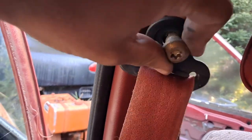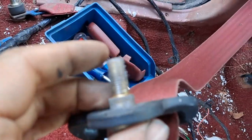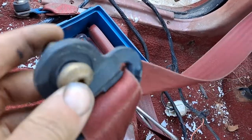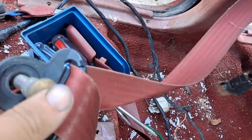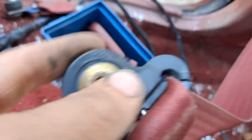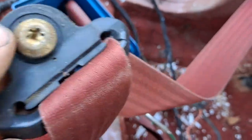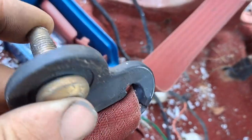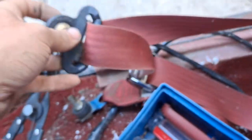We'll remove this top one here. The top one is still just a T50, just like the other one. On my EXPs these all seem to be the same — tops and bottoms. There's nothing to this one, it's just a bolt. And then the seat belt pivot retainer actually has a coating of plastic rubber on it, so that alone becomes the spacer/washer insulator for that. We'll set that also off to the side, because now we can remove all the trim pieces.